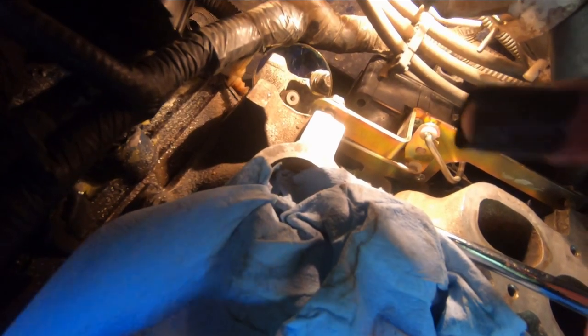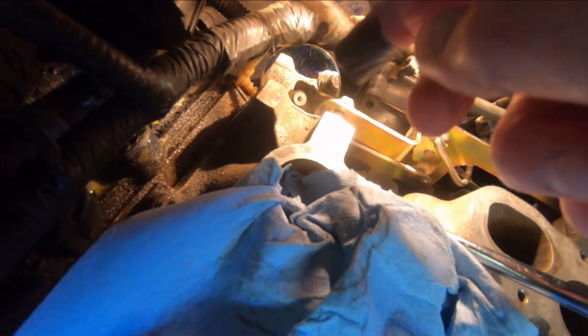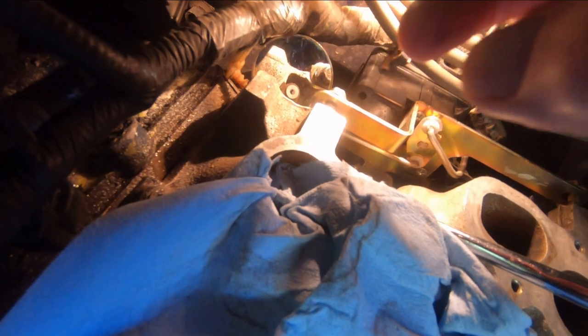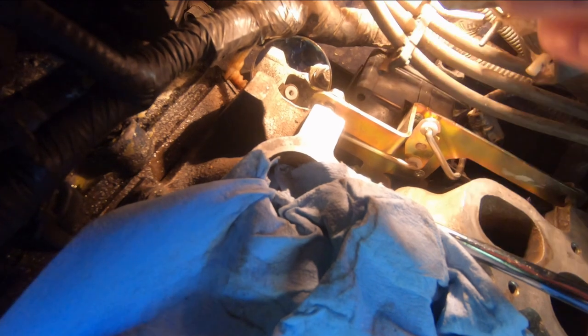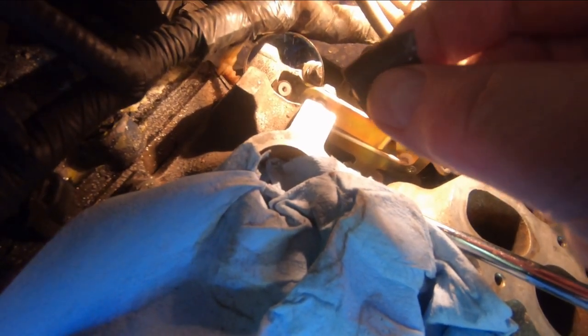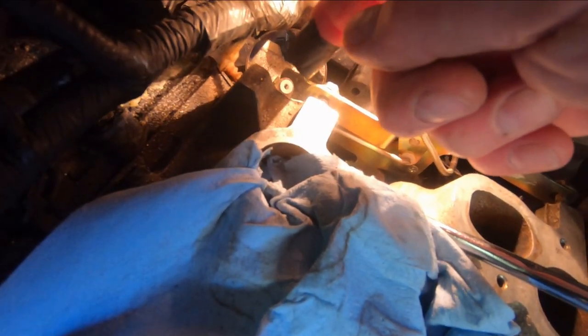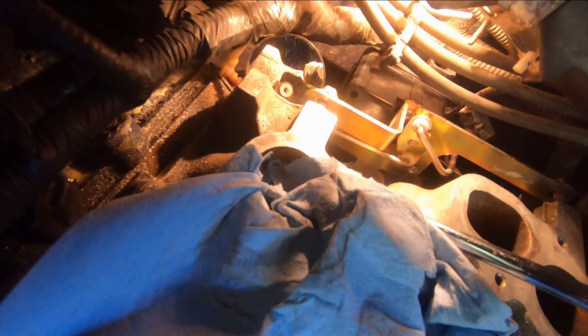Okay, so I managed to get that bushing into the bracket. And how I did it was I put black tape on my finger, sticky side out. I wrapped it around. And then I looked back there, and I pressed another finger against the lever, and came back with an impression of which way the square was facing. It was kind of off that way a bit. So then I put the bushing on the tape in the same orientation, and I gently put it down in there and moved it back and forth until I could feel it in the hole, and I pressed it in.